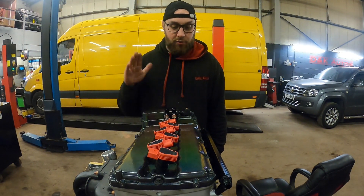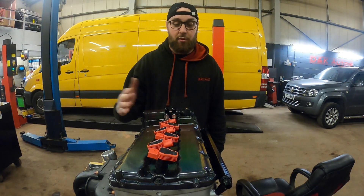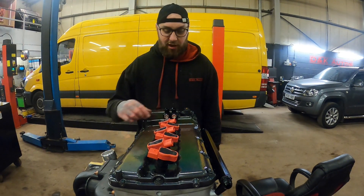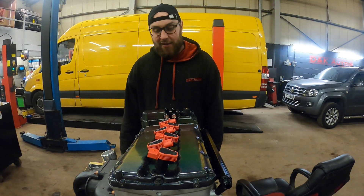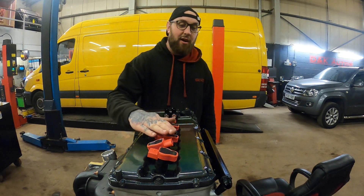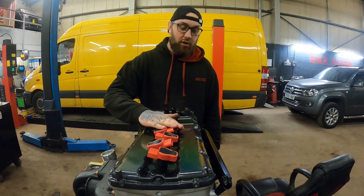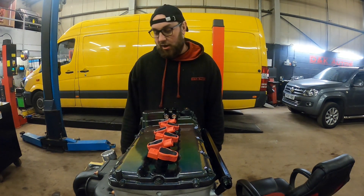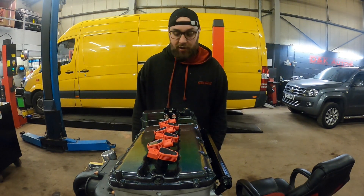Two steps colder NGK iridium plugs, NGK R8 coil packs. I went NGK just because I like their stuff and never had a problem with them — the OEM ones are made by Bosch but NGK are pretty much top class for spark. On my BMW 135i I did the VANOS conversion and used these NGK ones with no problems. So: NGK coil packs and plugs, two AN10 fittings for the breather, Prismatics Universe on the cam cover — that pretty much covers today's video.